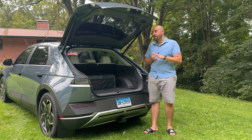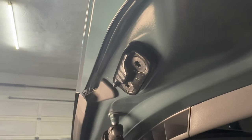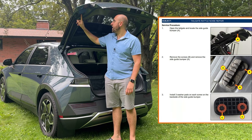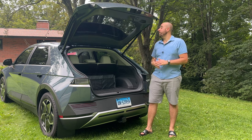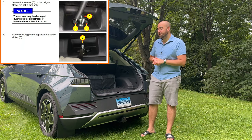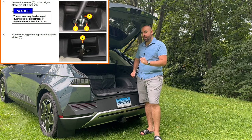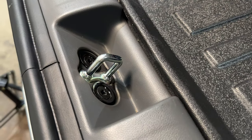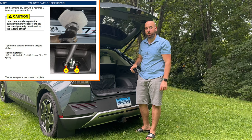When you look at this TSB, they're actually doing the reverse of what I did. So instead of putting a spacer there, they're actually putting a few washers between this piece here that is used for clamping the hatch shut and the body right here. They're going to do that on both sides of the car. And then the funniest part of this TSB is they show some photos of the next step — a technician takes a giant screwdriver and a giant mallet, puts it right here on this strike plate, and goes boom a few times. That's probably going to make it so that it closes the hatch just a little bit tighter.